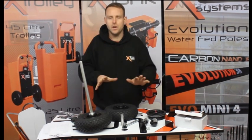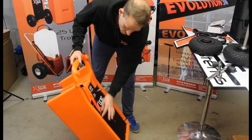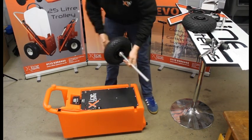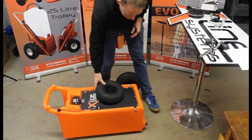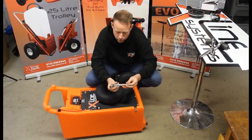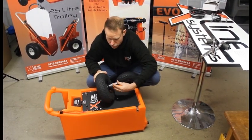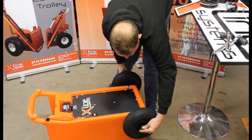We start with the carcass and begin by putting the axle on — slide the axle through, get the second wheel and the four parts. Slide the 14mm washer on and the sleeve, then put it through the actual wheel making sure the inner tube fitting is on the outside. Slide that through, put the wheel spacer on, and screw that in.